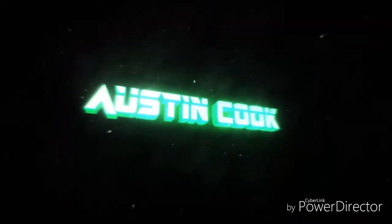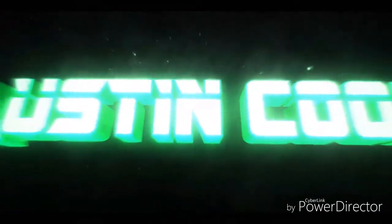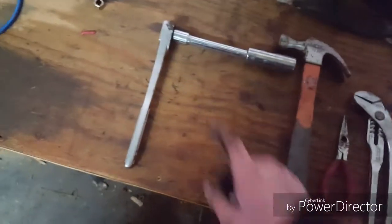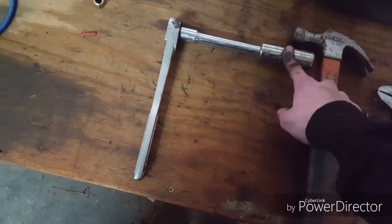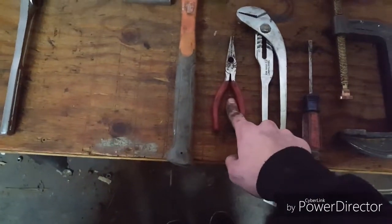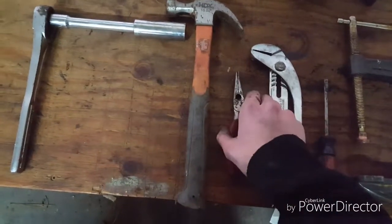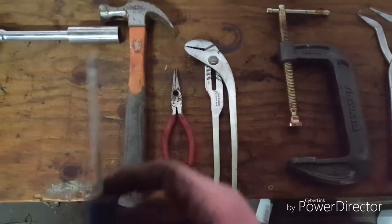Let's get dirty. For a brake job, the tools you're going to need are a ratchet or a four-way with the socket size you need to get your tire off, a hammer — you don't want to beat the crap out of whatever you're hitting, but it comes in handy — needle nose pliers, channel locks, and a flat head screwdriver. You want it fairly small so it'll get into those tight places.